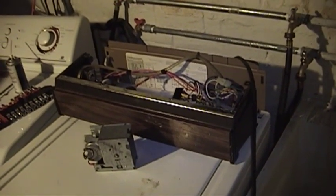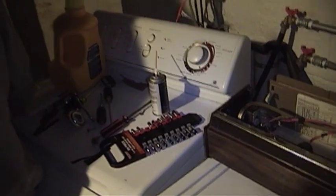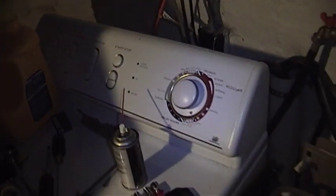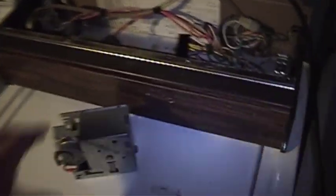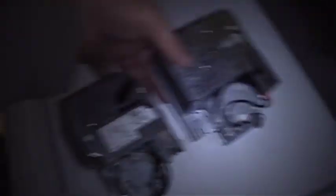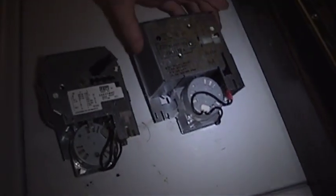As far as we know, it's been pretty reliable over that time. It's certainly been more reliable than its sibling over here, the Maytag Neptune, which if you ask me was definitely the beginning of the end for a once great company. In fact, this machine is exceedingly temperamental - it doesn't like to fill properly, it doesn't like to stay on to finish its cycle, whereas even when this thing was dying, it was still trying to work. Let's go ahead and unbox the new timer. You can see that not a whole lot has changed over the years as far as these are concerned - the assembly has been simplified and definitely cheapened a bit. But if you place the two right next to one another, you can definitely see there's not a whole lot of difference between them. Even the motor is very much the same thing, just a little AC synchronized timing motor.